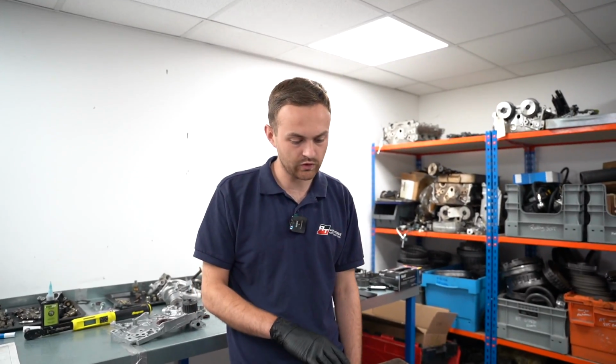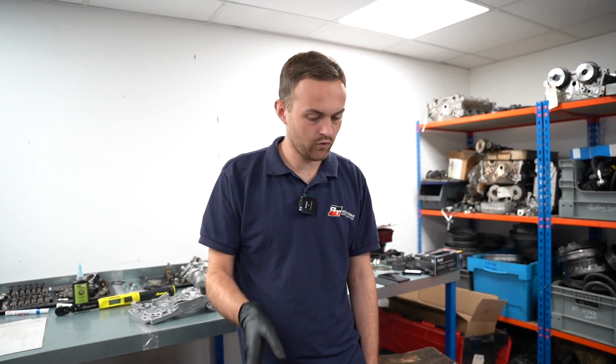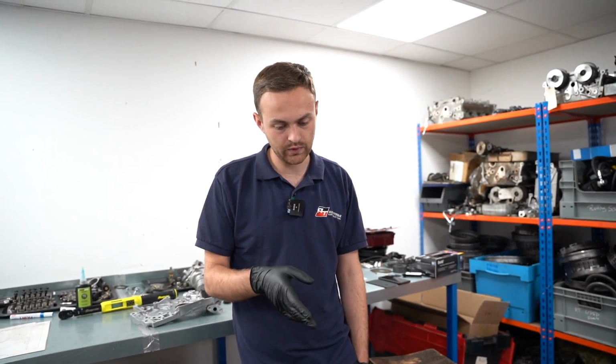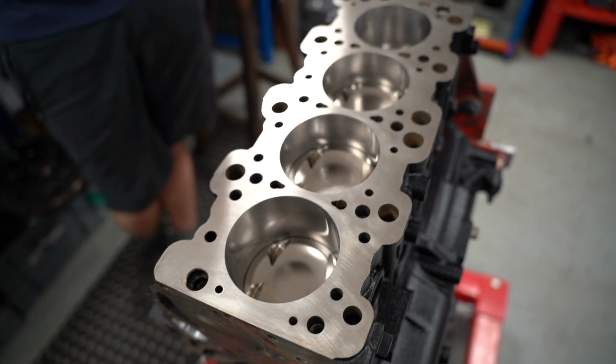Last time we spoke, stuff would have been getting cleaned up. I think I was grinding piston rings, etc. Fast forward a little bit, all that's now complete. The rods and pistons are built up and in the block. It turns over nice, all the tolerances have been set and all the clearances have been checked, and we're all happy there.